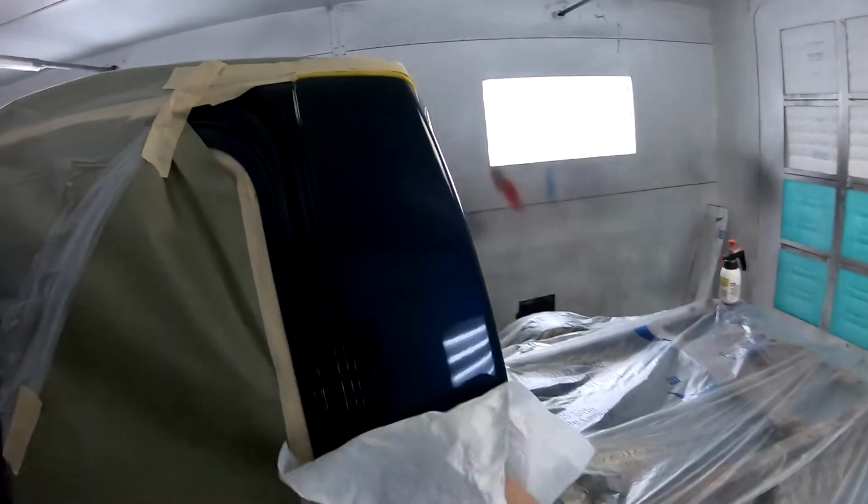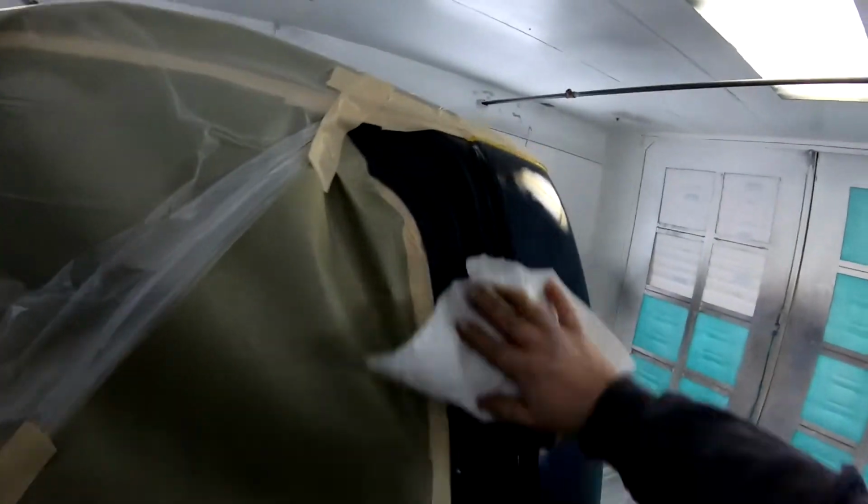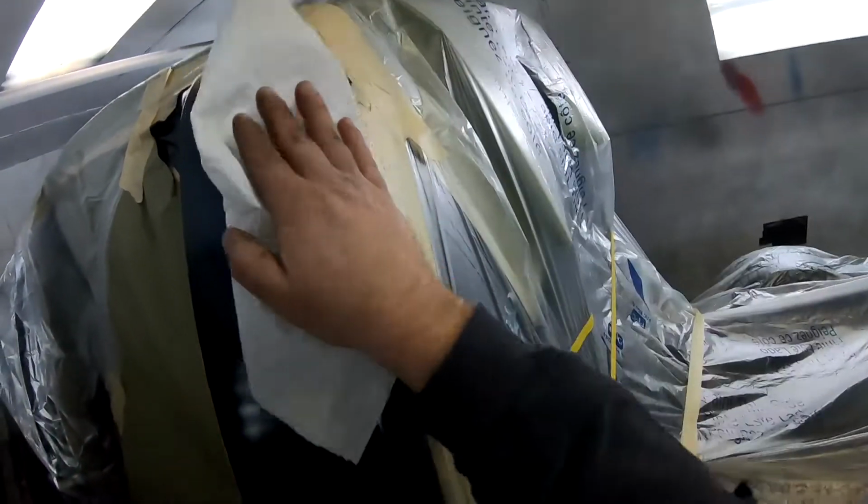So you're doing the Miyagi on this. You're putting it on, and then you're wiping it off. It's wax and grease. It does exactly what the name says. It takes off wax and grease. So the thing with this stuff is people leave the residue sit on it. That is a no-no. You have to get it off as dry as possible.